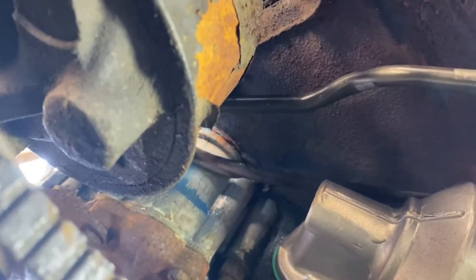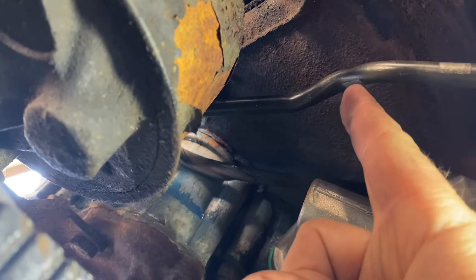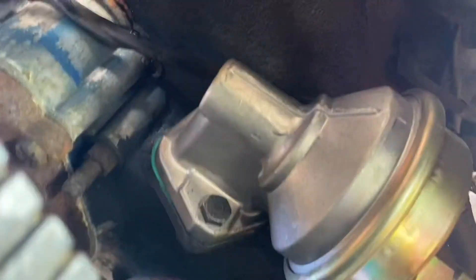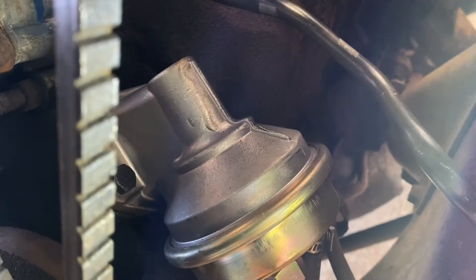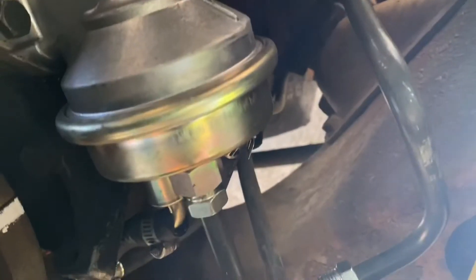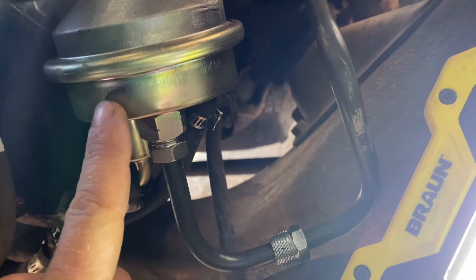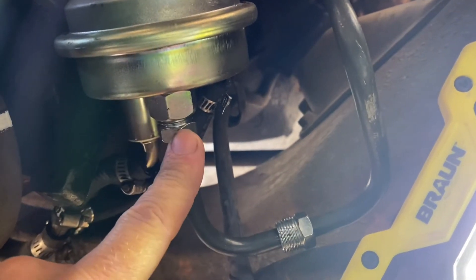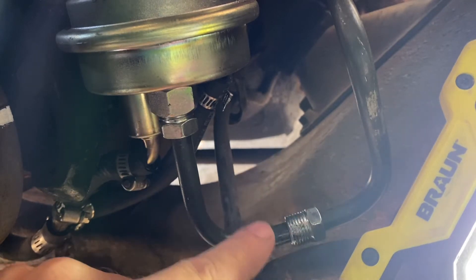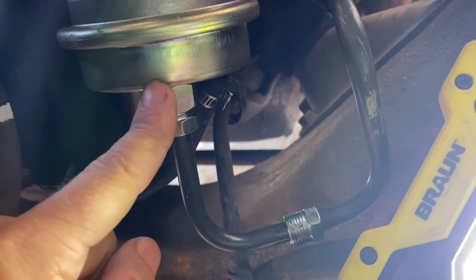This is not going to be the easiest thing to see. Right here's our power steering pump, here's the lines coming down. I've got about an inch, maybe a little more, off the block — you can see it's not touching, plenty of space — and it comes down towards the fuel pump. This is where the last one turned to rubber because either it had a hole in it or they couldn't get it off, so they just cut it. What I did was go ahead and make two 90s at the very bottom. Now, I didn't bend that with the nut in the wrong place and then have to cut another line to get another nut — that never happens. But if it does happen, don't try to straighten it out; you'll just ruin it. Either way, solid steel line into the pump.